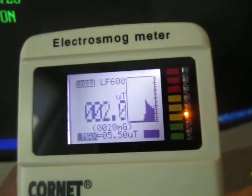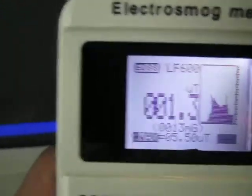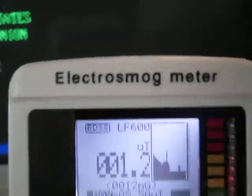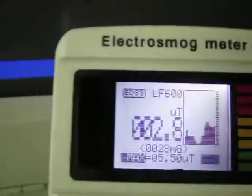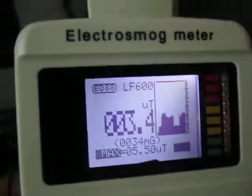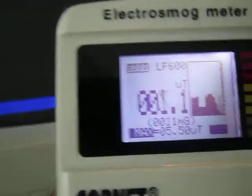You can see that it's in the yellow range. I just touched the monitor with the EMF meter and the picture changed, so I'm going to try to avoid that. Up at the top, as we move down, the readings seem to increase significantly. The worst parts of the magnetic field are towards the bottom, probably the center bottom of this unit, and along the sides as well — you pick up some pretty high readings there, relatively speaking.